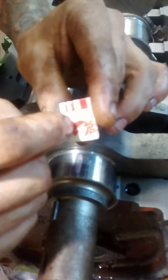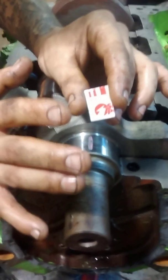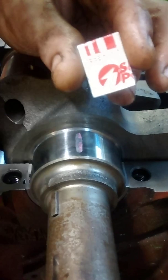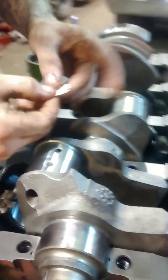So long as you're not down here in the four, five, and six range — that depends on if you're burning a nitrous engine; you may want to be down in that level. This is not a nitrous engine. We want good oil pressure and good reliability. So we're in between two and three thousandths of an inch. On this one here we've got two thousandths, which is awesome. The factory spec is right around two thousandths, but since this is a performance engine, you want a little bit more play than that.